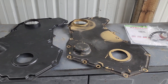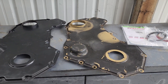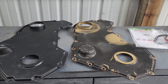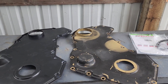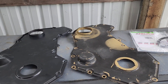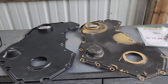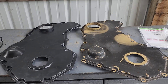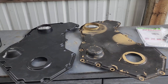There are differences in these timing covers from different years. In my research, a lot of the oil leaks are most common to the front seal, so it's really crucial that you put it in right and there's only one way to do it. What I want to go over first is getting the right timing cover — and I don't just mean the year, I mean buying a factory OEM one.